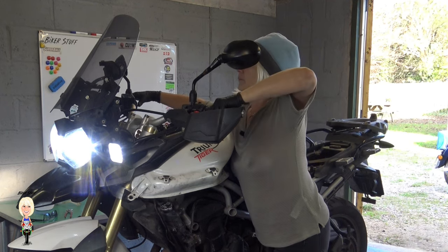Open the garage door. Now, start the engine, blip the throttle a few times, and after about 30 seconds, turn it off. Once again, take the radiator cap off and check the level. If it needs refilling, do that now.